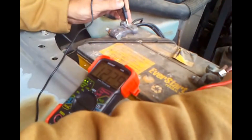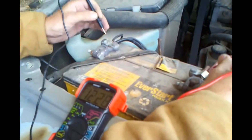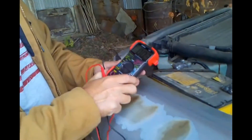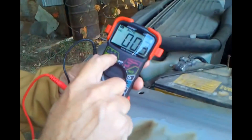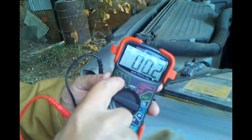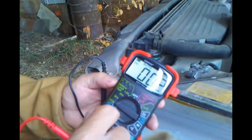As you can see, it's reading 12.30 volts, which is good, and the green test light is lit up on the meter indicating the test is good. If the battery was low or you have a dead cell, it would most likely show the X indicator, or if the battery is just low it could show the question mark light.